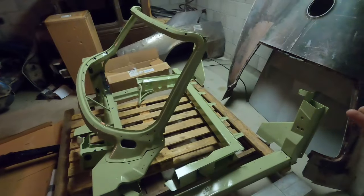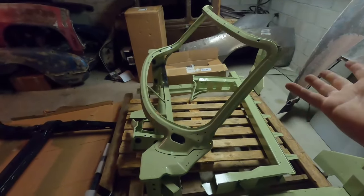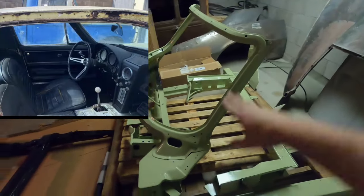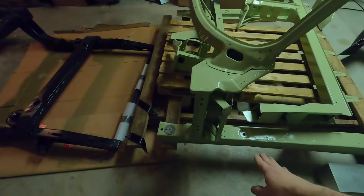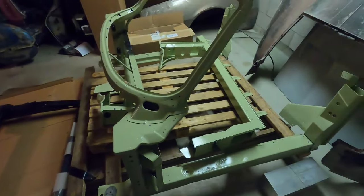You're going to want to look at the chassis to see its condition. If the car was closer to the ocean for most of its life, they typically rust from the top down — the top half. And if you have a car that spent its life near salt on the roads in the snow, they typically rust from the bottom up. So that's something to keep in mind.